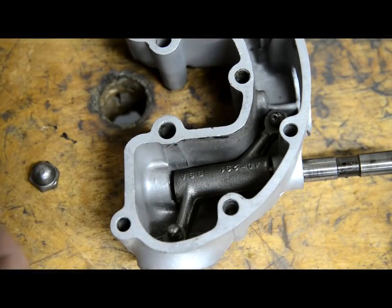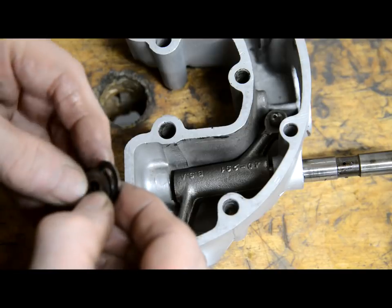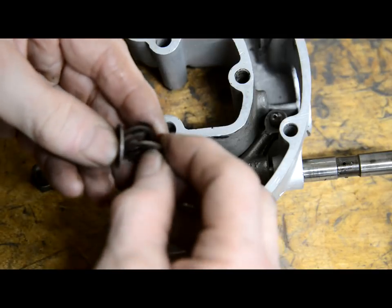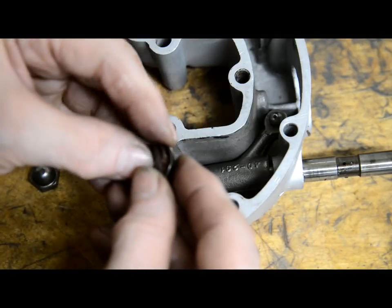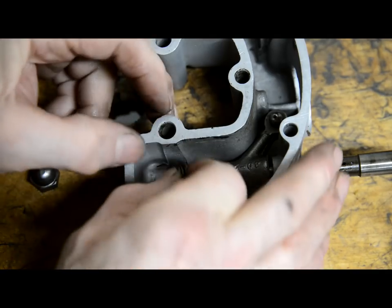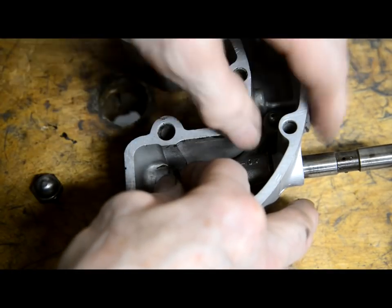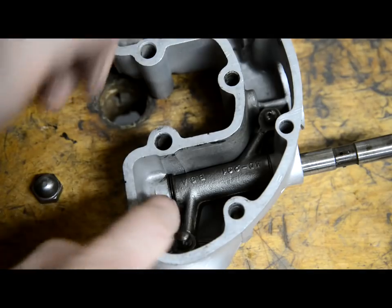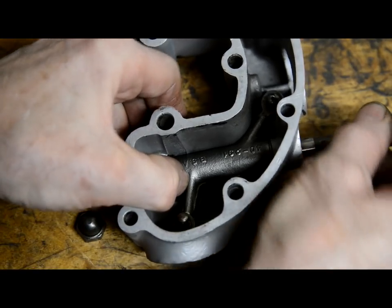Fit them in there. Sorry, but you're in the way. Right. Make sure you keep the washers on the outside of the spring. And you'll notice one side is thinner than the other side. Well, not thinner, but it's easier pushed in, so we'll get that. Goes in there. And this, as I say, if you've got those two washers the wrong way around, then when you start pushing this in, it goes so far and it won't go the rest of the way.